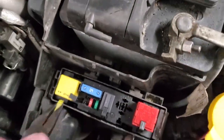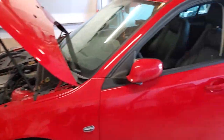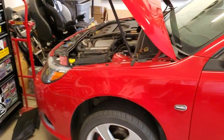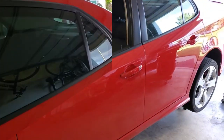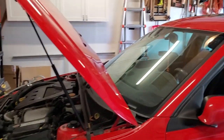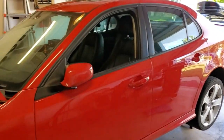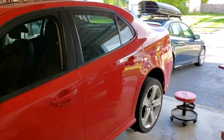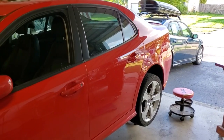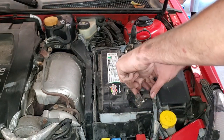The engine is idling. We pull the fuel pump fuse and wait for it to stall out or come close to stalling, then shut the vehicle off. Even with the garage open, step outside to avoid carbon monoxide. Once it stalls, we've used up as much fuel as possible. If you can plan ahead, drive the car down to near-empty before this repair, because all that fuel weight in a full tank will be coming down with it — or siphon some out. It's also a good idea to disconnect both battery terminals.